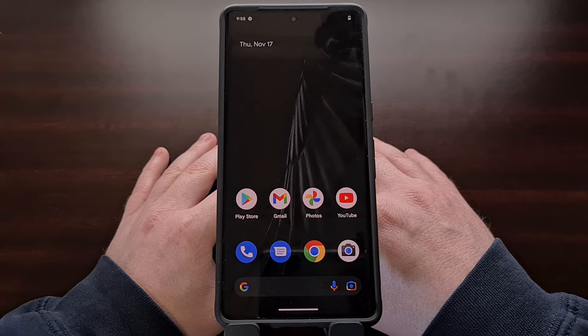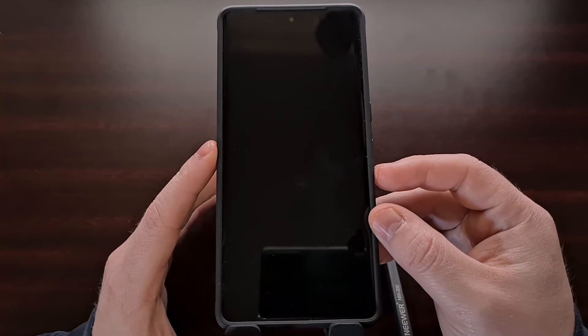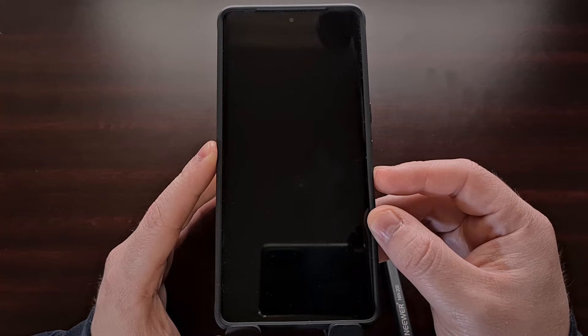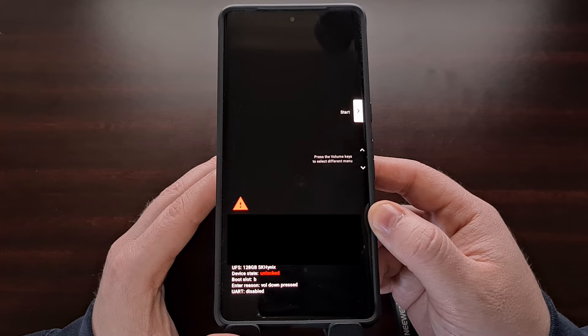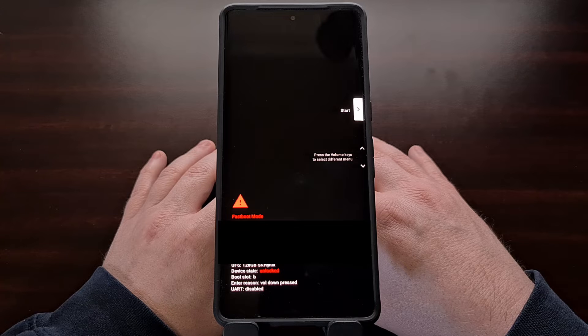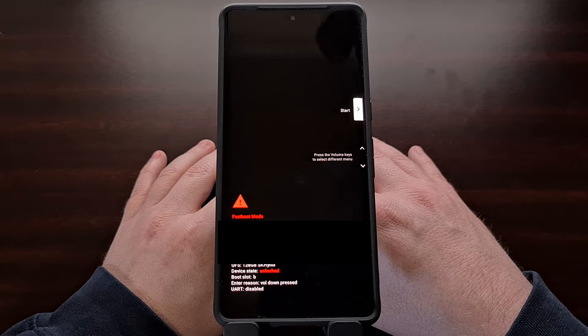After that part is set up, we need to boot the Google Pixel 7 or Pixel 7 Pro into fastboot mode. This can be done with either a button combination or by executing the command ADB reboot bootloader. If you're not familiar with this process, be sure to check the video description below for a link to a dedicated video on how to boot the Pixel 7 series into fastboot mode. Now that we have the phone in fastboot mode, connect it to the PC with a USB cable and then open up a Windows PowerShell, a command prompt, or a terminal window within the same folder as our ADB and fastboot tools.